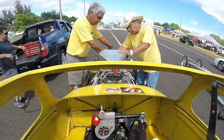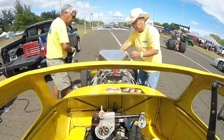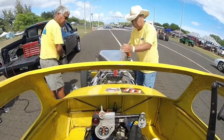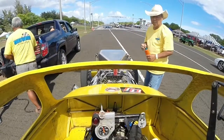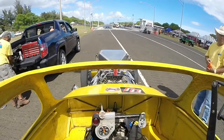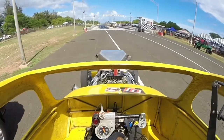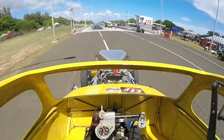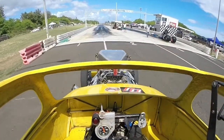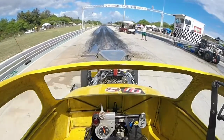Here it lights, you feed, back off on the bottle, it starts to die, so you feed again to keep it alive. It stays lit. The driver shouldn't intervene — he should just let the crew handle the car. Don't give it throttle, just let the crew keep the car alive. The driver should just be checking oil pressure and making sure that's okay.